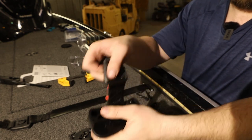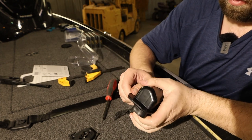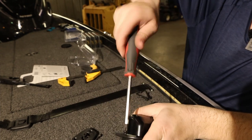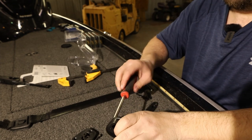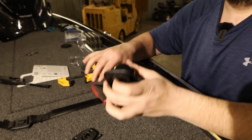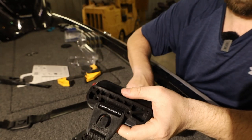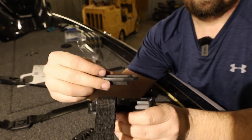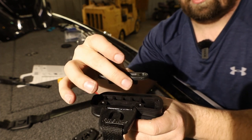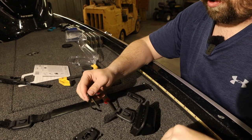Line it up — might have to pull the buckle out itself, which isn't too big of a deal — and then let it back down. Got it all lined up again, go ahead and put our screw in and tighten them both down. Now we have our mounting plate for the conceal mount. The conceal mount will go over this, and you will have screws that go through the conceal mount and screw into that mounting plate, sandwiching our deck in this case.